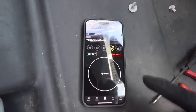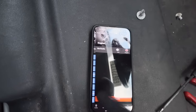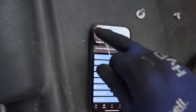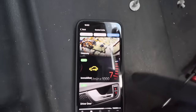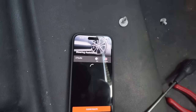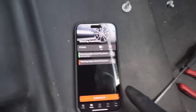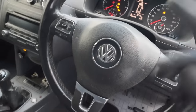The steering fault is still there — that's absolutely fine. Engine faults are clear. It's found two faults: steering angle and steering assistance. That's fine because the battery's been off. All we have to do is rotate the steering wheel to full lock one way and then the other, and that will clear that one. So the only fault found so far is just the steering.